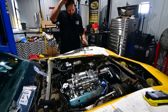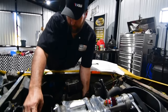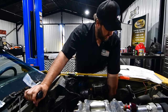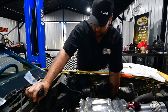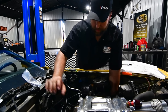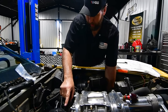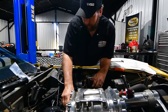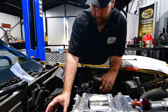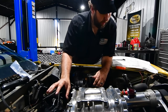I'm gonna bump it over again. Get the top dead center. It should be coming around. Might have just heard it. That was the compression blowing out against my finger, and my whirly-woo here is lining up with my borrowed marker mark. So this would be top dead center right there. So she should fire off right about here.